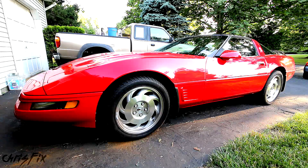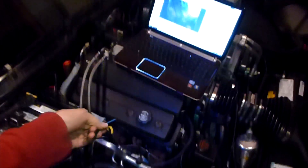First up is my Corvette engine — a 1996 Corvette, 350 cubic inch 5.7 liter engine with about 90,000 miles. Here's cylinder number 2 on the passenger side. At the top we can see the valves are an orangish color. The exhaust valve is slightly open on the left because we're at the top of the stroke on an exhaust stroke. The valves look nice and clean. The cylinder looks pretty clean — there is some carbon buildup on the outside of the piston, but a little fuel cleaner will probably help that out. The middle of the piston seems pretty good, and that orange reflection on the piston is from the clean valves.